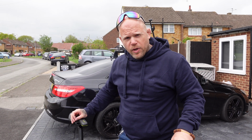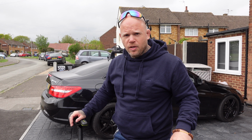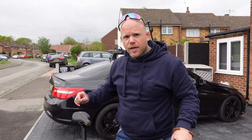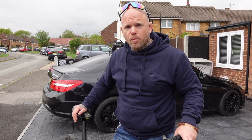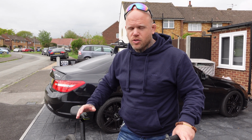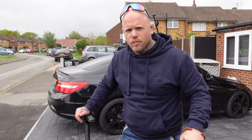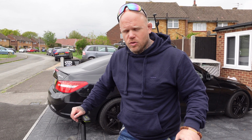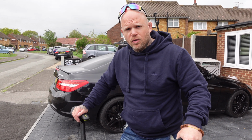Sorted it, got the back wheel in, done the spacing, it seemed to change gear, seemed to brake, adjusted the caliper, and then realised that the derailleur was rubbing against the freewheel, so had to take it all apart again, fit another spacer. It's just always something. It's always something when you're converting these, getting it right, it's just time consuming. But yeah, it's always helpful if you can get part of it done at the bike shop.